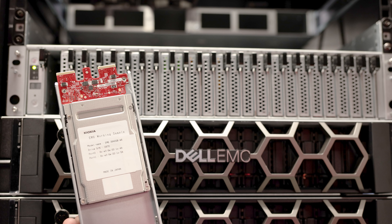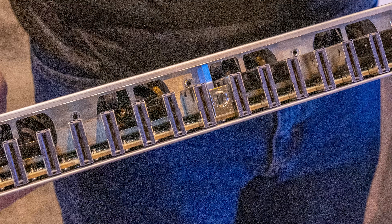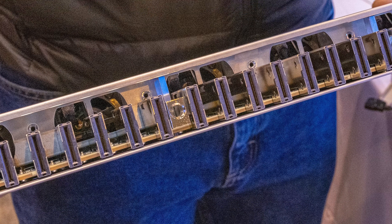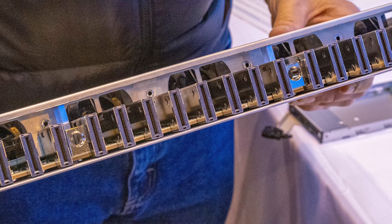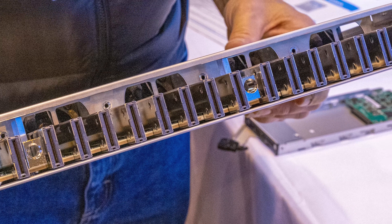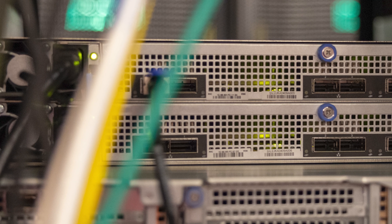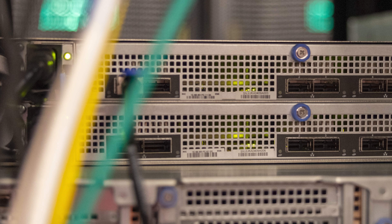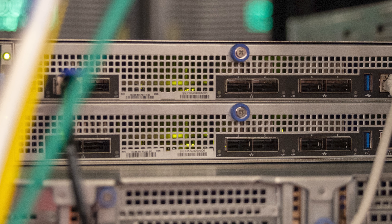Something you're going to notice is that these drives say two different MAC port numbers — there's port zero and port one. There are two different MACs because these are actually dual-port drives. These are really going after SAS, and to go after SAS or dual-port NVMe, you actually need to have dual paths to a given storage device. So we have those two EDSFF connectors, and when we get to the nodes powering them, this is where some of the real magic happens — way beyond the physical interface. We actually have a bunch of connectors, but only one row of connectors on each node.